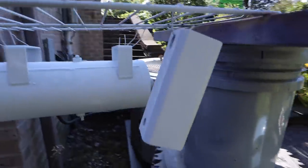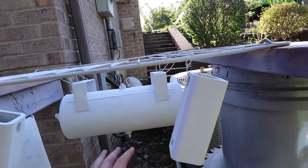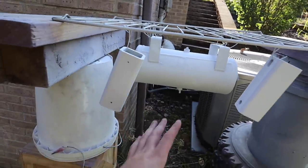So we had a little party foul on that one — this slid down the rack and nicked into that one and knocked a whole bunch of powder off. Now if this was being painted that'd be an issue because you'd have to strip everything and repaint it. However, what we're going to do is throw some more powder back on here and we should be just fine.